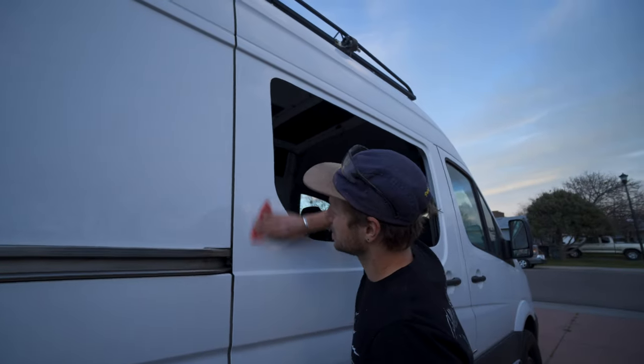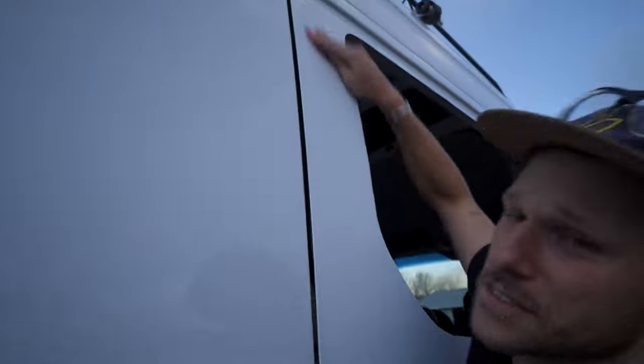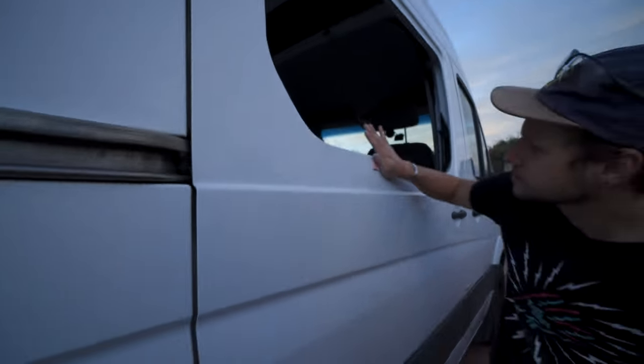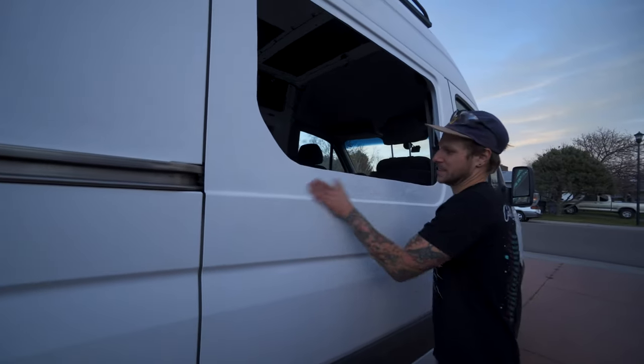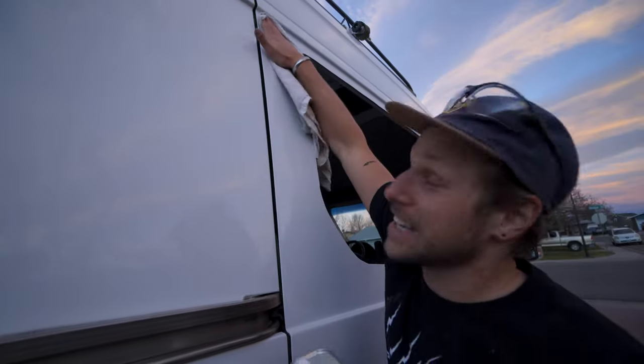The first thing I did was rough up the edges all along our cutout. We don't want to go too aggressive — you don't have to go to bare metal. I figured it wouldn't hurt to rough up the surface on the van so that the primer had something a little more substantial to bond to, since that's what we did with the flares. We also made sure to clean up any dust or debris that was on the van with some mineral spirits. And with that, it was time to apply our primer.